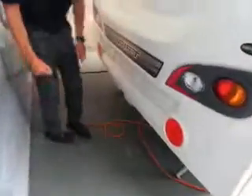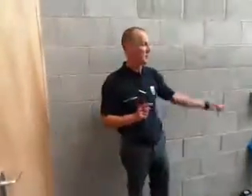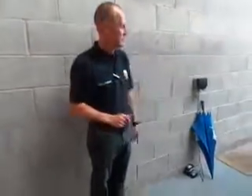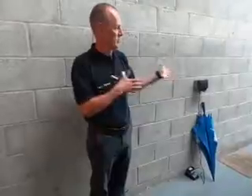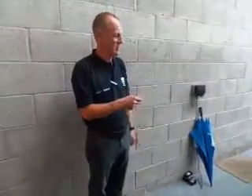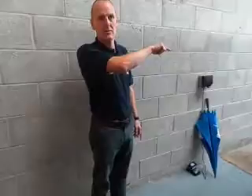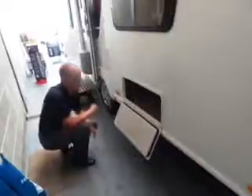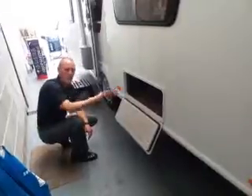Your leg points are just at the back. Always make sure you put at least one leg down at the back if you're going into the van. You don't need all legs down if you're just jumping in quickly, and if it's still attached to the car that's holding it - so if you're doing a pit stop in a lay-by or service station you don't need to put the leg down.